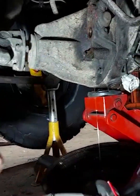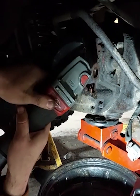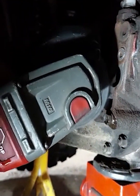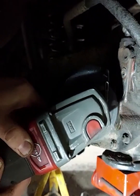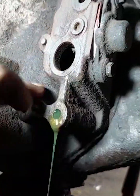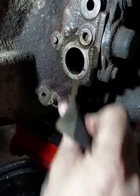This is where you get oil in your face, so just chuck an old bolt in for now. Watch your eyes, cameraman. That's a bit cleaner — no rusty lumps on it. Good trick of mine: a bit of emery paper, use the oil that's already on it, and just clean the faces off so you know they're a good seal. You guarantee a nice clean seal that way.